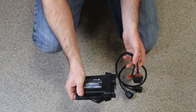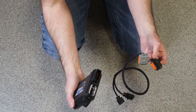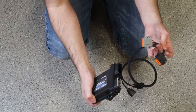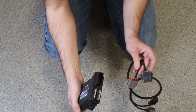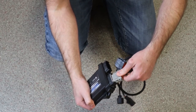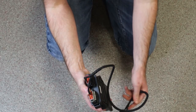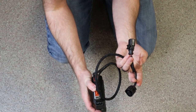Before we go to install this, let's show you how to plug it in. It's going to come shipped with a harness for the applicable vehicle — they have a variety of different ones. Basically the ones we're going to be selling are the plug-and-play versions. The gray connector goes in with the gray housing and there's pretty much only one way you can plug it in. There are two slots on one side and one on the other, and these go into the vehicle in between the two connectors we're about to show you how to disconnect.